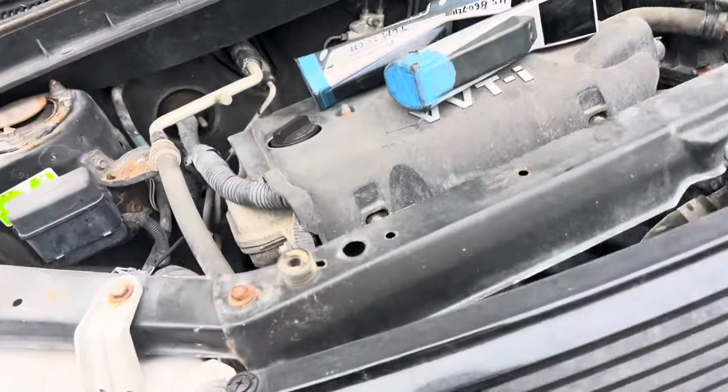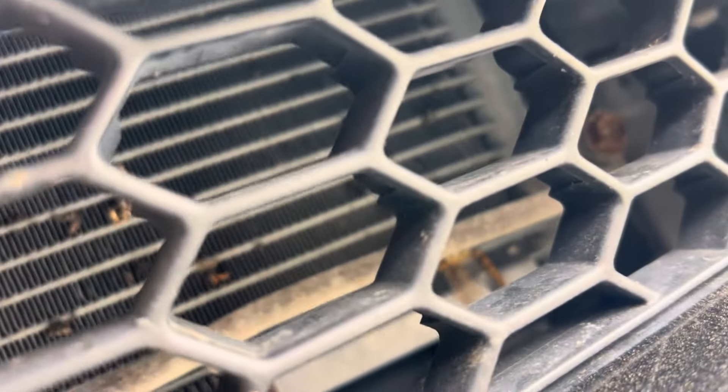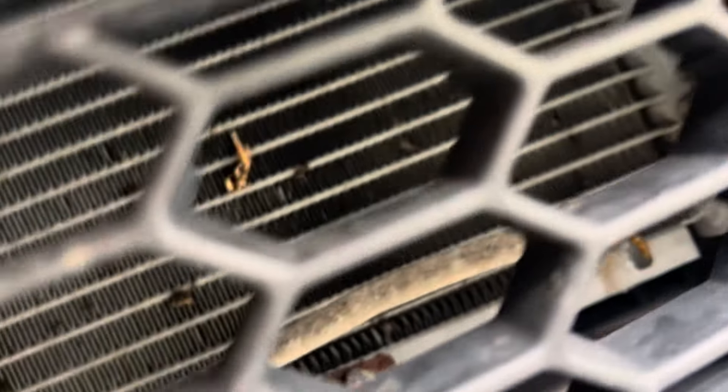You can see all the green, and you can also see it in the sight glass right there — so it's the front shaft seal. I'll keep looking for more leaks, but what I notice is there's probably been a body repair, because that's a pretty brand new condenser for this old Scion. There are almost no bugs in it, and this is a big opening, so there'd usually be a lot of rock damage at high mileage.